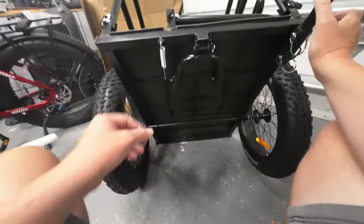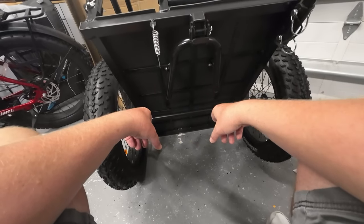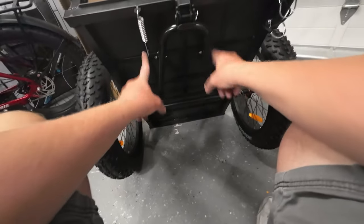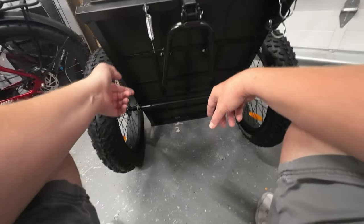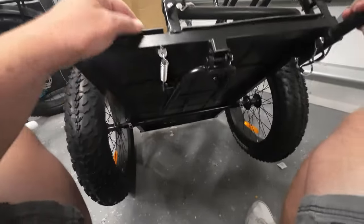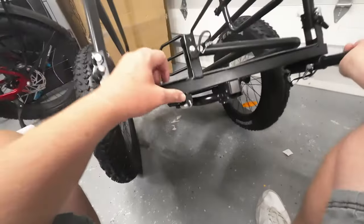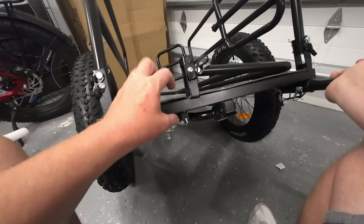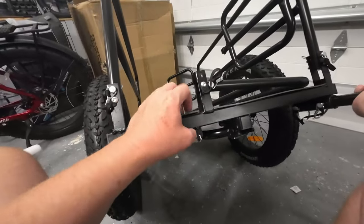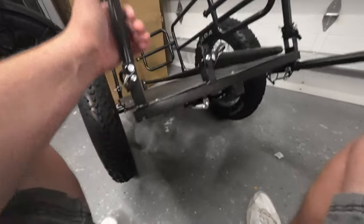The underside is just thin metal welded on in a grid pattern — about five-inch squares, three going down and four going across. That's what provides the support. And then you have this really thin backer board, whatever this is. A good thing about this is it helps keep the trailer lighter so it's not real heavy. But I could foresee this — it's already bubbled up a little bit here at the edge — I could foresee wanting to replace this with a quarter-inch sheet of plywood or something maybe. That said, our trailer is assembled and ready to go!